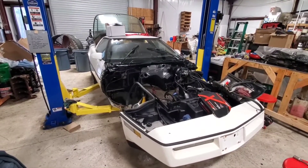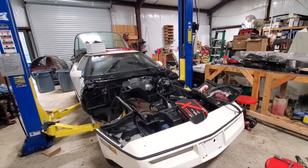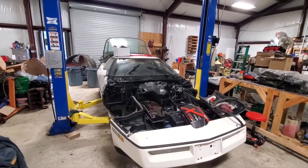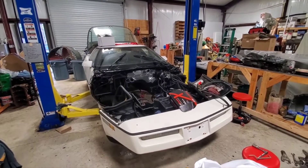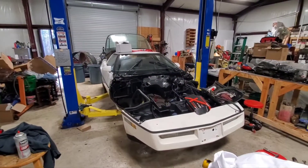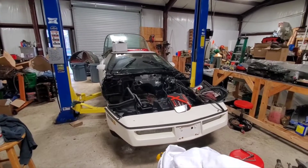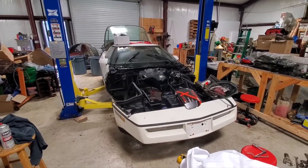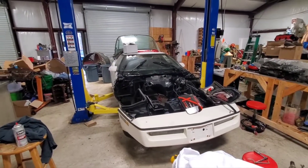We did not go with a stock ECU — we went with a Holley Terminator. I did not have a verified good ECU nor a wiring harness, and by the time you procure those things, even if you go to the junkyard and get a hundred-dollar ECU and wiring harness, the amount of time spent repinning and doing everything else — it was just easier and faster to go with the Holley. Plus he might decide to go forced induction in the future, and I'm not a big fan of Gen 3 forced induction tuning. The kind of hackery that goes into keeping things on the map is aggravating, time-consuming, and seems a little inconsistent. Plus we get some fail-safes — boost cut and things like that — with the Holley that you don't get with the stock ECU.